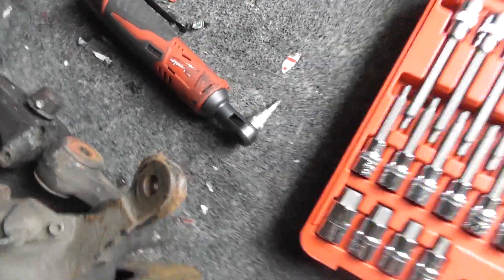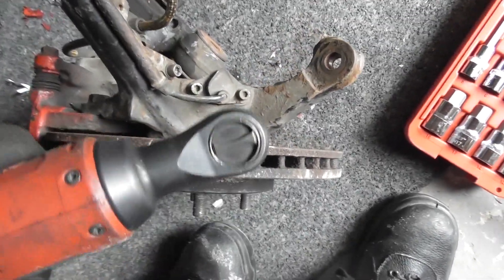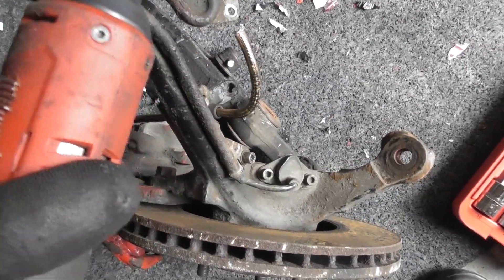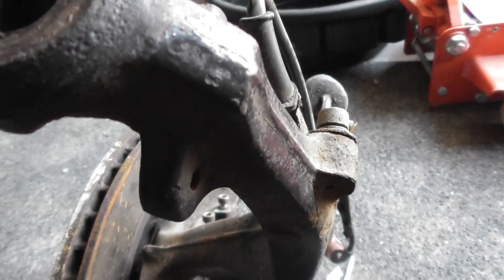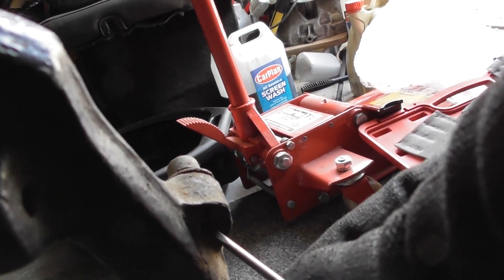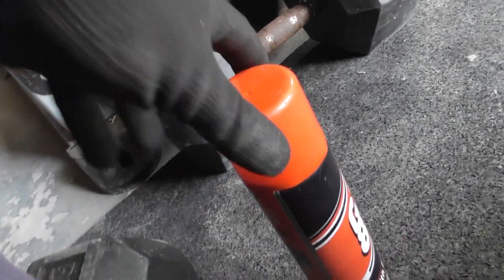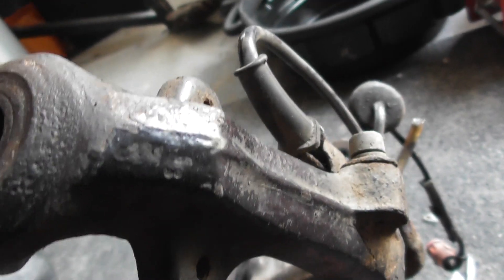So I'm going to start off by taking the ABS sensors off. It's all on a 5mm, and someone's put these Allen bolts up in there. These bolts have been a bit harder to get out, so I've just gone in behind, scraped out some of the dirt, because this is where the bolt screws into. Then I'm going to get some penetrating fluid — GT85 — put the straw in, spray it in there, leave it for a bit, and hopefully I can just get this little bolt out.